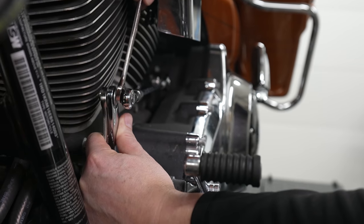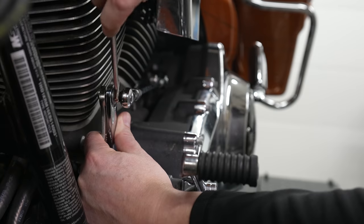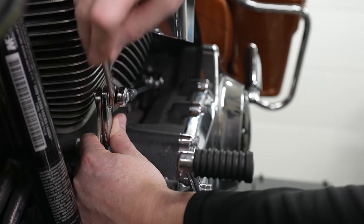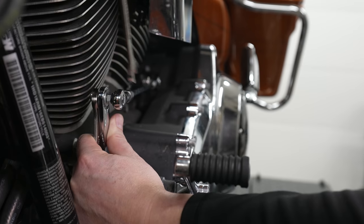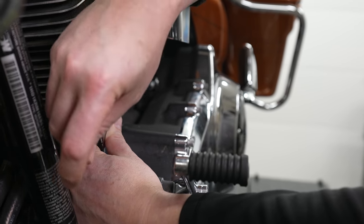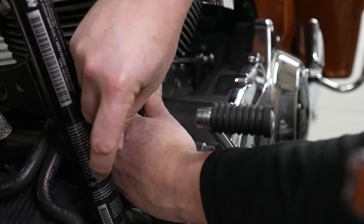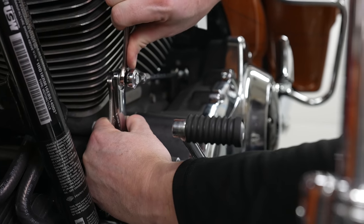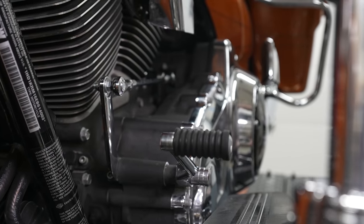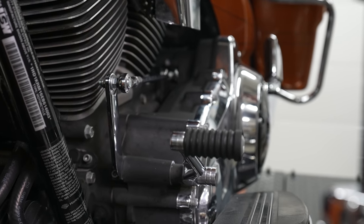He's going to tighten the front down now. On the front, that is an 11-millimeter wrench — it fits a little snugger than a 7/16ths. On the back, he's holding the nut with a half-inch wrench. It's quite a long stud so it takes a few cranks to get it all the way in. Be aware the rear threads had some Loctite on them — it comes with the kit — but the front doesn't need it because we're putting a lock nut on the back.